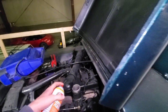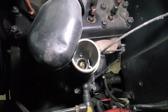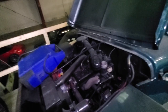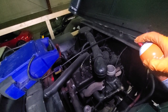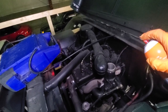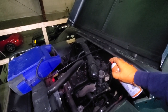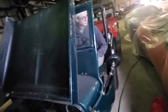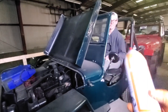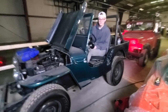I should probably tell you, don't put your face too close to that if it blows up. Look at this little baby carburetor - it's so small, it's so cute. Let's try this again - I think it might go. This will at least give it a one-to-one old gas to new gas ratio. Ethan is going to try and start this thing up - I'm going to man the starting fluid. I think we're running on starting fluid. It's alive - no, no. It was straight up running on the starting fluid. But we got it going, it runs. I think it's safe to say we have a fuel delivery issue or just straight up bad fuel. So anyway, 1946 Willys - she runs.